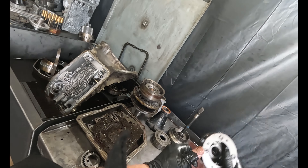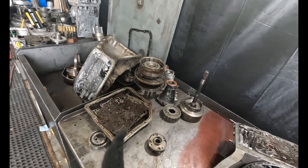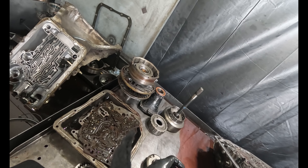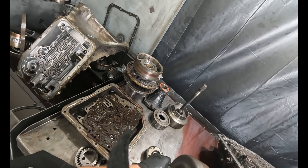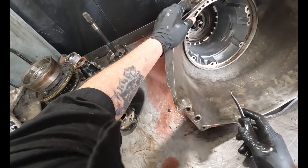The splines look good, but his planet was fine — he doesn't need this part. He just needed the two drums and the case. The shell is all rusty, needs sandblasting, a little slop in it, needs new bushings — but savable for somebody else.